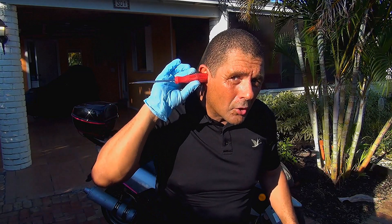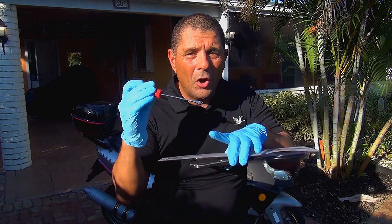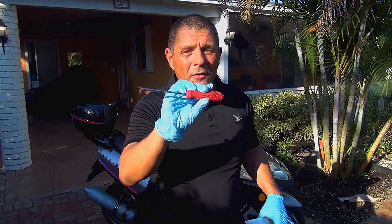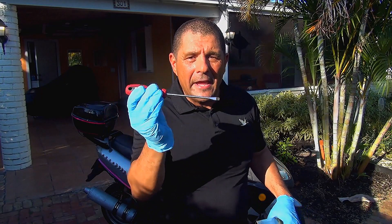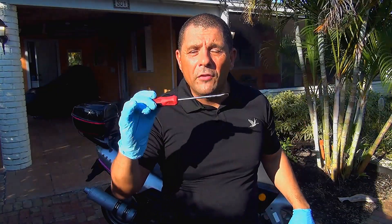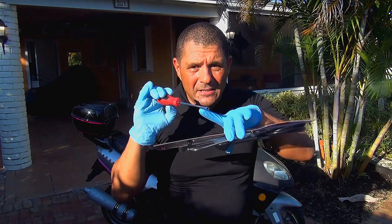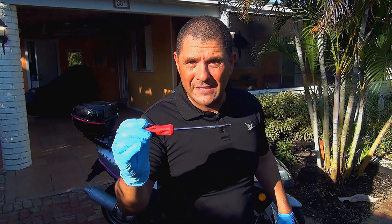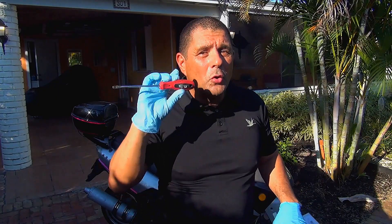There are a few ways to check a noise that comes from your motor. You can take a flat screwdriver, place it right here on your ear, and point the tip on the place of the motor that you think is making noise. You have to make sure you don't point the tip on any moving part — if you place the top part of the screwdriver on a moving part you might hurt yourself.